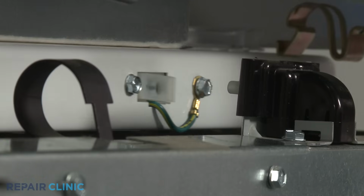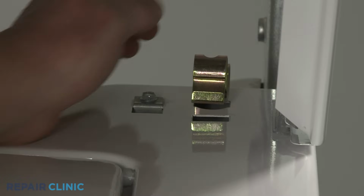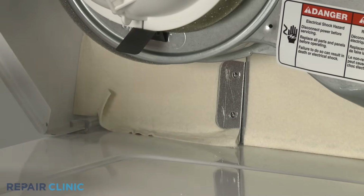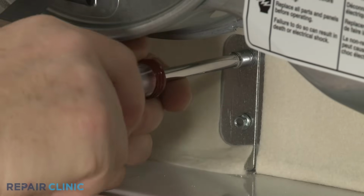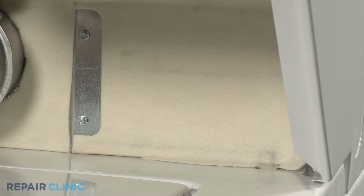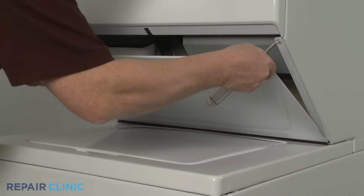Be aware the lid switch wire connector on the panel needs to be fully connected with the receptacle on the frame. Reinsert the two spring clips to secure the panel. Reposition the rear access panels and rethread the screws. Reinsert the access panel clips. Reposition the lower access panel and secure it with the screws.